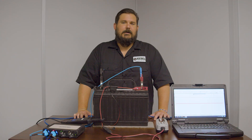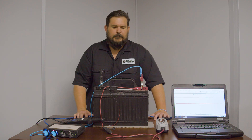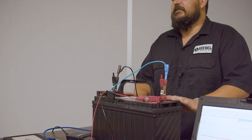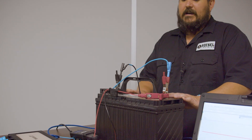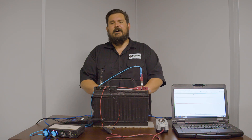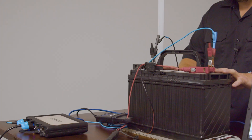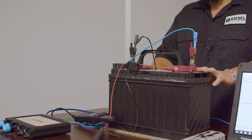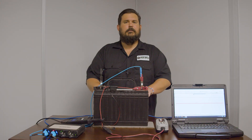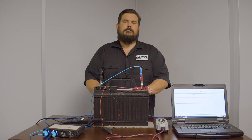We all know batteries are great — we use them in our cars, trucks, jet skis, motorcycles, and so on. In everyday usage, they typically give you somewhere around three to five years, maybe sometimes seven to ten. I've got a battery at home that's almost 20 years old that still works, but three to five years is the most common lifespan. That covers flooded cells, AGM, and lithium ion — all battery technologies have a lifespan of around three to five years. I want to talk about something that can help you expand that lifespan, and that's something called a desulfation charger.